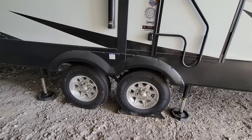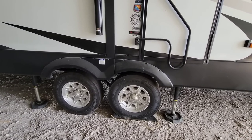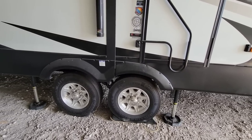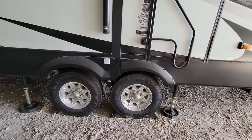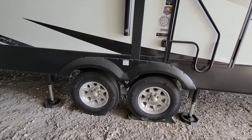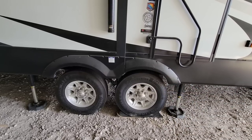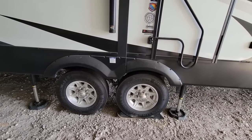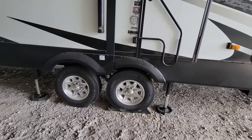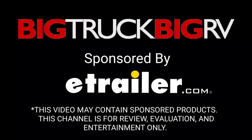Some folks will say upgrade to a full independent suspension. Every time I've inquired about that with the folks who make the frame — Lippert — even though they carry their own torsion style axle that meets and exceeds the capacity of the RV, they say that fifth wheels just aren't really designed for it unless they're designed that way from the very beginning. Most of them aren't simply because you lose equalization and it adds additional stress and leverage to your frame that they don't recommend. This is coming directly from the engineers who manufacture the frame. We do not prefer doing it on fifth wheels that come with leaf sprung suspension. If your RV came with torsion suspension from the factory, it was designed that way — the frame was spec'd for that type of suspension. Anyways guys, I sure hope you enjoyed this video. Please take a moment, subscribe to my channel, give me a thumbs up, and we'll talk to you again very soon.